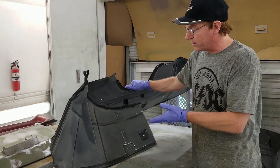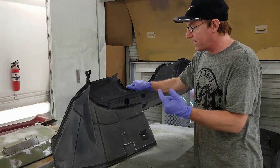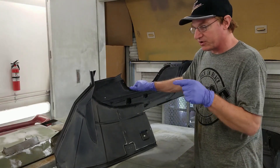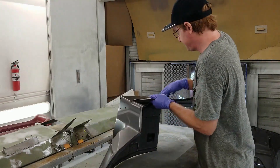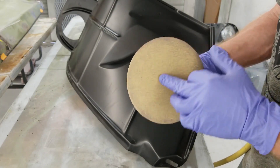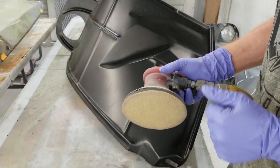In this process it doesn't matter because we're going to be going with an epoxy primer to seal the EDP, and then right after that with a 2K primer. The 2K primer will go back, sand and work out any little scratches or imperfections to make it pretty so we can paint. For sanding, we're going to use a Snap-on DA — it's got a bigger pivot swing point — and we're using 220 or 320 sandpaper. I don't need anything crazy on this; I already know I've got good coating, I just want to make sure I can grab my material.